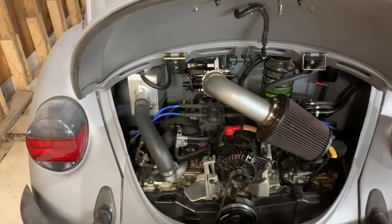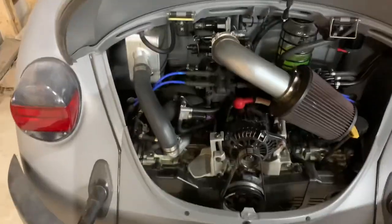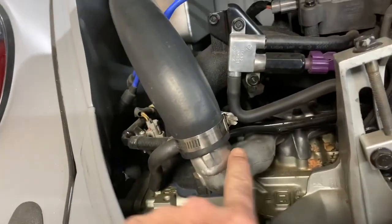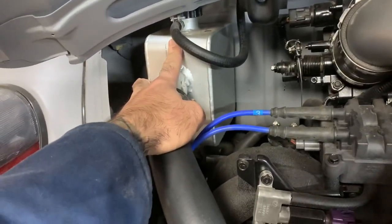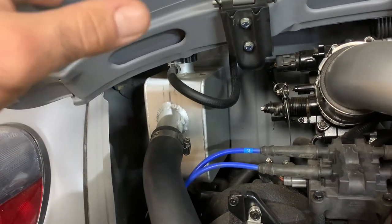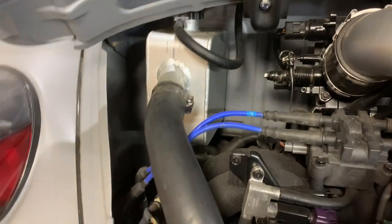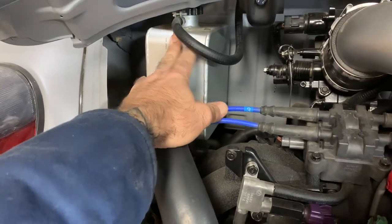I just wanted to make a little video of the coolant system. What I did personally — I got the crossover pipe, I modified it so it just comes up. It's a couple of cuts, turned them, got them welded up into an expansion tank here. What I do is I just take the cap off, put a big funnel on top, fill it with coolant, and the system just goes down. Having the big pipes lets the air come up through and escape in this big giant pipe here.